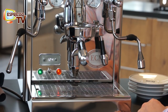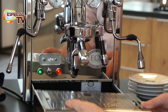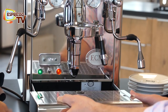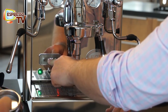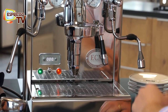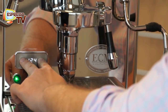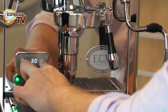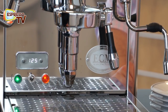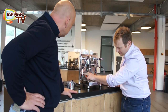If you have reached the value of 30 coffees, it will count backwards from 10 to 0. This is the time where you have the blind filter installed. The blind filter is found here on the base of the machine. The display shows 10 and goes downwards for cleaning — on, off — and this helps you remember to clean the machine. The other function is the eco mode: I can set a value — eco mode means standby after a certain time. Like, I can put it to 120 minutes. By default we set it to zero, so the customer has to adjust it. After 120 minutes — two hours — the machine will go off.